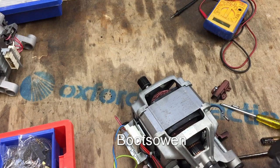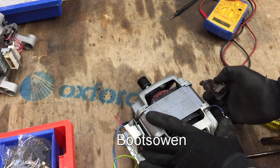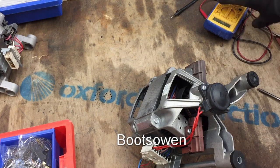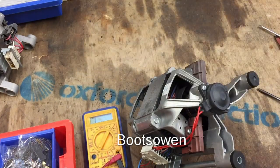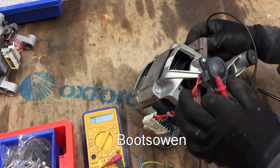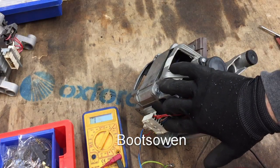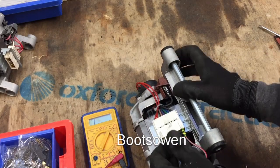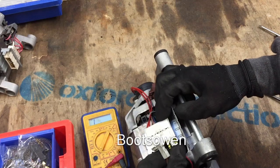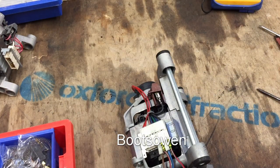I'll find another one — the joys of keeping everything. I've got a spare one, should do it. Here it is — it's got a little tiny bit of life left in it, about as much as the other side. Let's bung it in and see if we can get it to play ball. So in all seriousness, that was probably all that was wrong with the whole machine. Let's just check this continuity — that's one brush, and on this one, that's the other brush. So there are the brushes — next three will be coils, and then the tacho. I've got it wired wrong as we stand, so let's pull one off, two off, let's put this in there. I've got a video on YouTube on how to wire these things and some of the thoughts and science behind it — so if you're interested in wiring these things and how to control the motor, check out that other video.